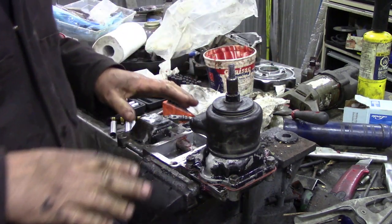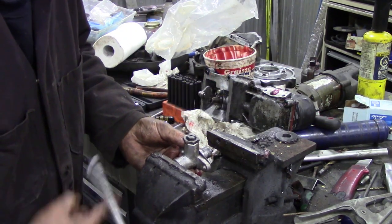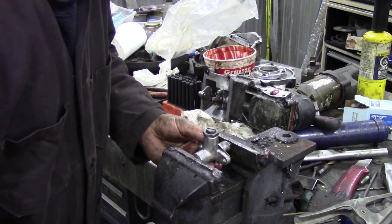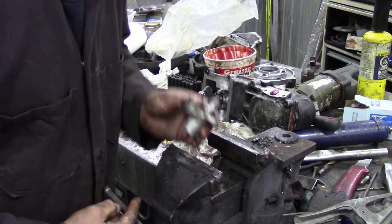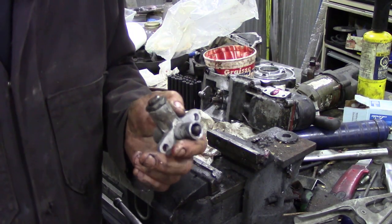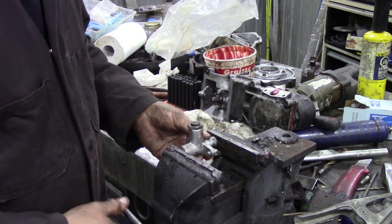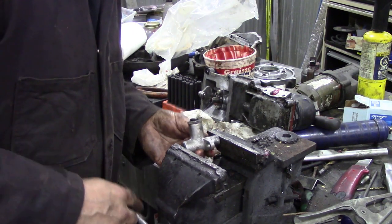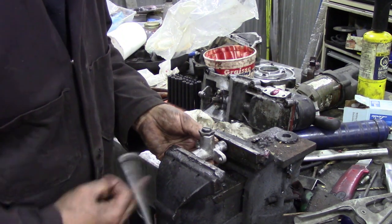When the gear shifts, it'll fit around that shaft - that's done. Now all we've got to do is find the rest of the gaskets, bolt this on, and we'll test it. But first - this is the reverse plunger - we're going to make sure this isn't seized up. Oh, I think it was seized up. Good job we looked at all these things. So now we're going to take the reverse plunger to bits - something I didn't really want to do but never mind.